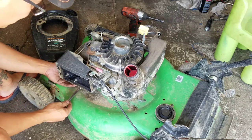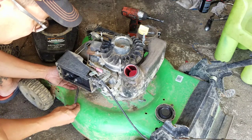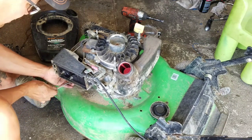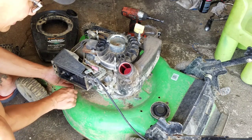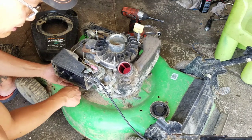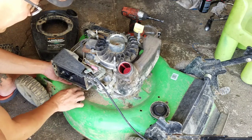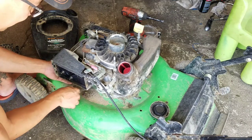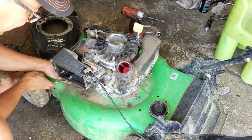10-millimeter wrench — why? Because Kohler copied Honda. That's really tight, which is a bad sign — if it's really tight it means that inside the bowl is dry, rusty, corroded, and it hasn't been run for a long time. It's a bunch of half turns and it's still hard to turn. That's a bad sign.